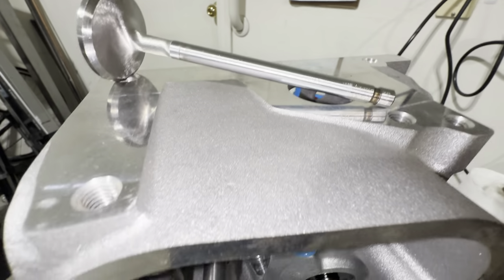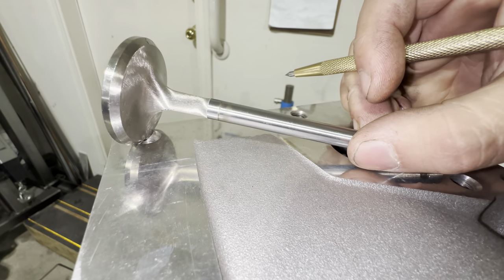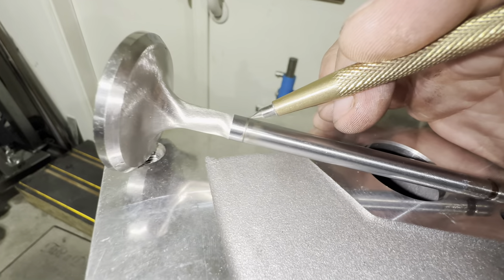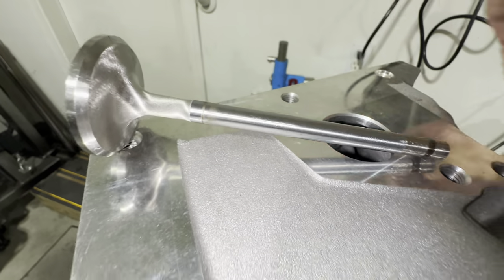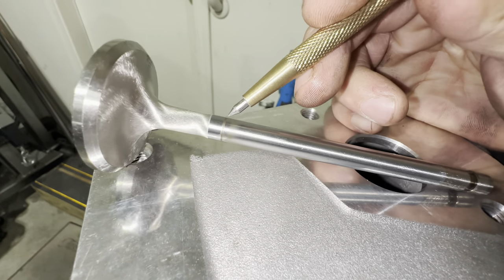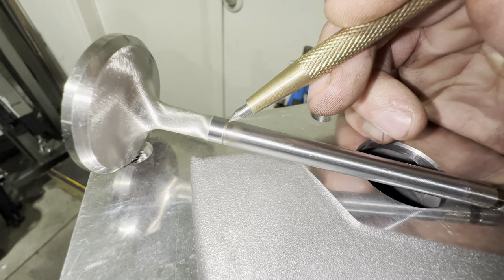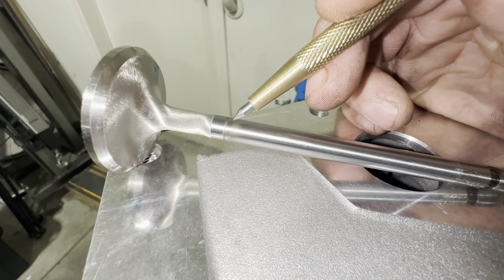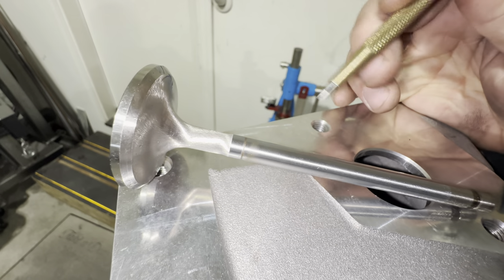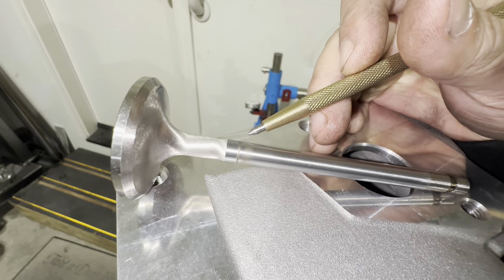Another thing I noticed — and this will be something you'll run into in a lot of production style cylinder heads where they're selling dozens at a time — a lot of times there's cleanliness issues. These things get pushed through the process pretty fast. Not only was there nice clean oil in here, but there was also a lot of abrasive debris from the valve guide machining still left inside of the guides. It actually dripped down with the motor oil used for assembly and just collected right there at the end of the valve guide. That's all grit, abrasive, and little tiny bits of bronze. That should have been removed — if all you're doing is washing your heads in a jet wash and not physically brushing out all your guides, it's likely you'll still have some grit left in the guide bores. Probably not a problem, but it does leave you open to a little bit of risk.